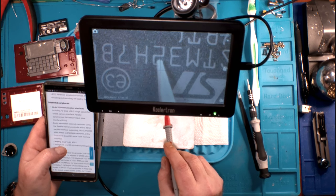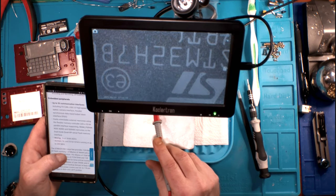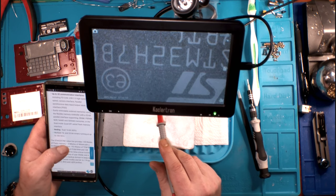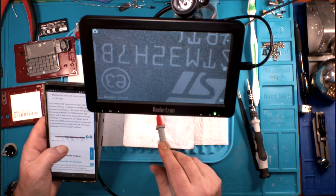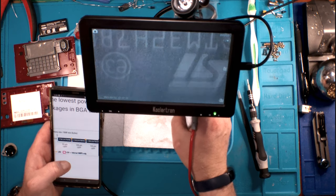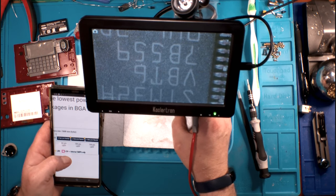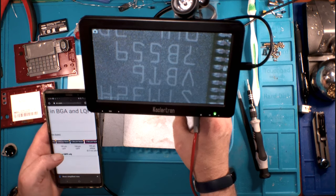So this does have USB 2.0 high speed built into it. It's got a parallel input-output slave, which is what is driving our other multi-in, multi-out MIMO chip. So that's not a bad little chip at all, is it? I've got the whole thing right here. So this is B0, STM32H7B0RB. We're looking for VB. So this is 100-pin LQFP is what we're looking at. This guy right here. Let me flip him over and see if there's any difference.